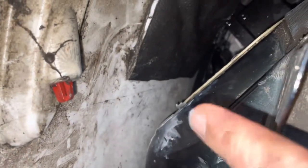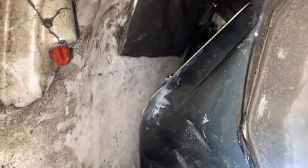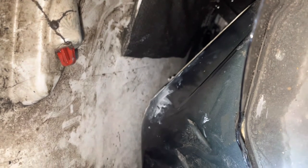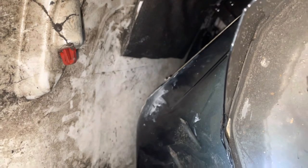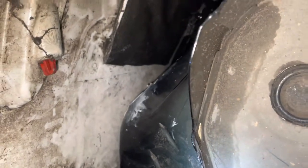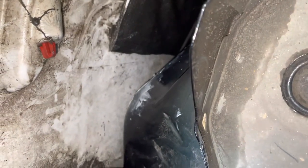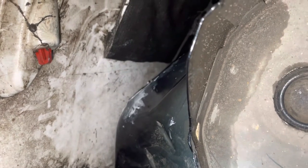You can make out the gray silicon there — it's been taped with the butyl tape underneath, siliconed in place, with the other tape put over the top and siliconed in place again. That gives a triple layer — double tape plus two layers of silicon. That is all done, and with 24 to 48 hours of curing time that will keep it nice and watertight.